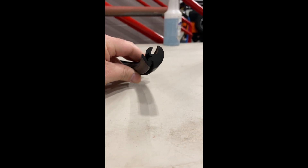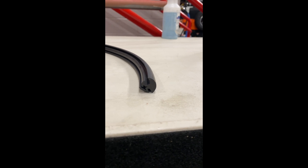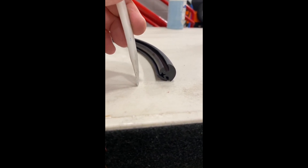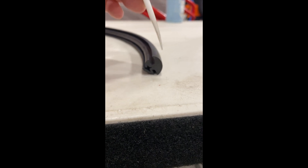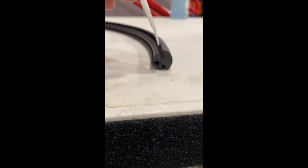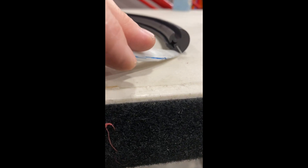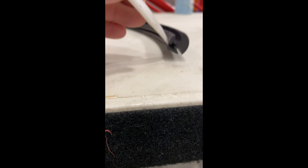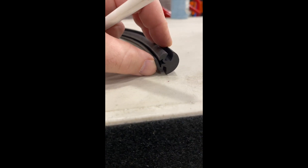This is the windshield seal. This is the correct way of looking at it in orientation — I'll use my pointer stick. This side will be the front of the vehicle, and this would be inside the vehicle. This thick part — a lot of guys put that on the front, they put it in backwards and the windshield actually comes out on them. We're going to put this all the way around your windshield frame. This down here goes onto the windshield frame, your glass goes in here, and then this gets peeled up and locks in underneath that lip — that's what we'll reference as the J-channel.